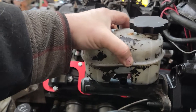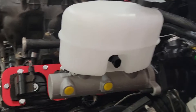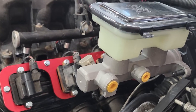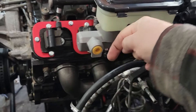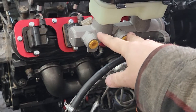I'm going to have to use that tiny thing instead. After going to O'Reilly's and Advance Auto, I've come up with a solution that won't have the brake booster or master cylinder hanging over the wall and into the hood — and that is not using the Chevy 2500 brake master, but instead one off an early Chevy S10, like 87 to 94 or so. Everything else is still the same, same bore size. And one thing I wanted was the ports pointing this way so I can make my brake lines come down instead of wrapping around. Got everything I wanted.